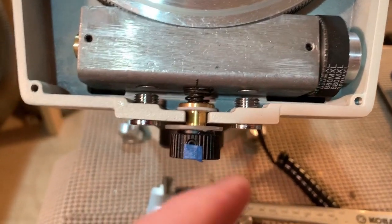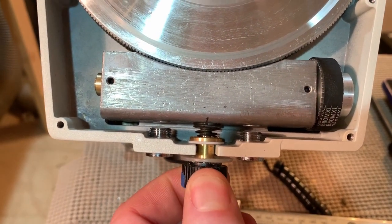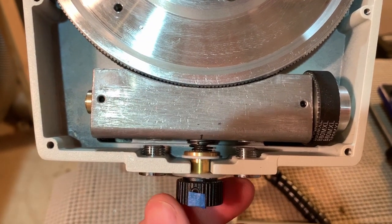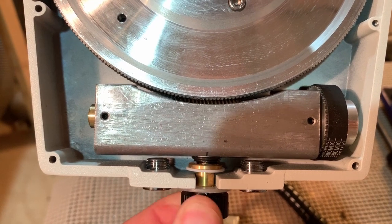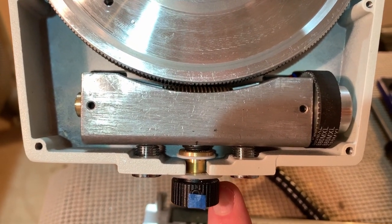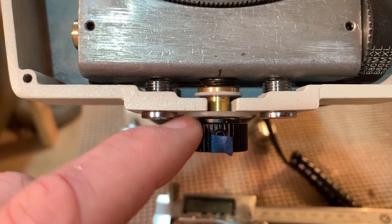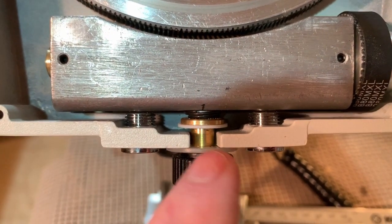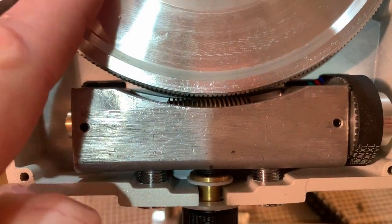Something I just tried is I added a little plastic washer right down in there. So this is fully engaged. If I thumb tighten it right there, remember about one full turn and it didn't do anything up here — and then that next quarter to a third turn, now it just started moving. That was one full turn right there. Before, the blue mark had to come all the way around to about another quarter to a third turn before it would fully disengage the gears. So by adding the plastic washer spacer, it allows it to push sooner, and now it actually almost touches those little hard stops, which it didn't do before. So now I just barely have to put it on the right edge or fully clockwise, and I know for a fact that these are disengaged.